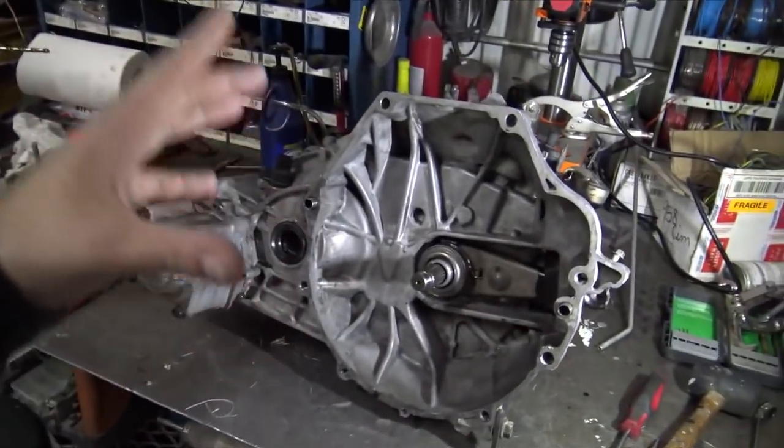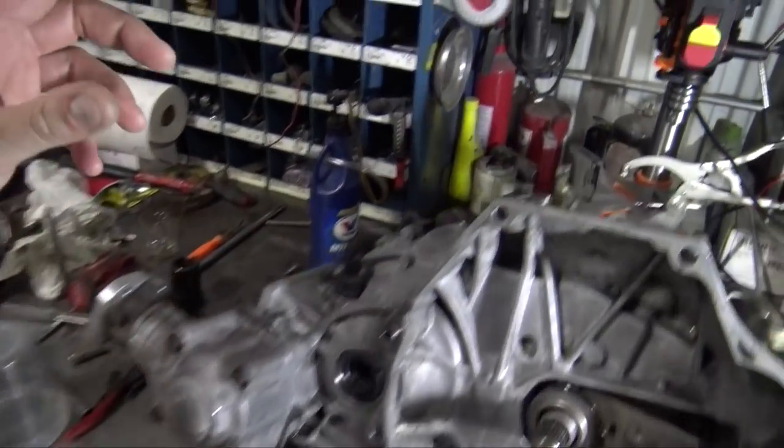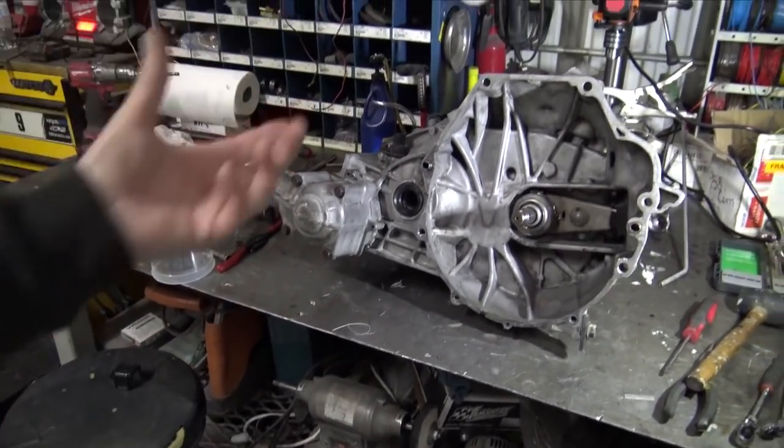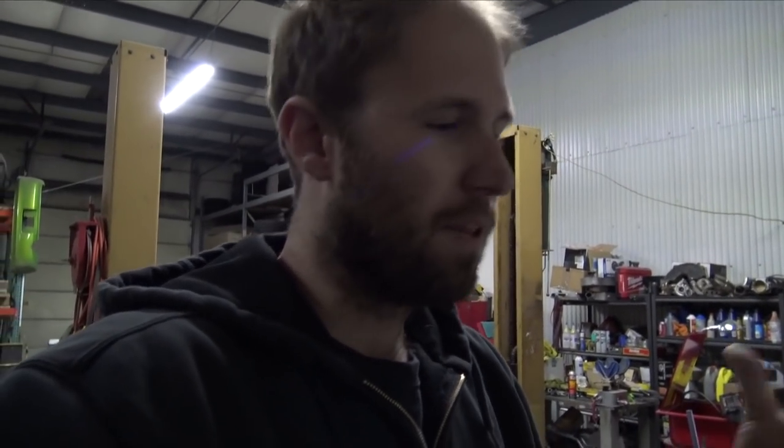There are a few little things you have to know about these. On the backside, as you saw, there's a little retaining clip, and that's really important because when you're pulling it apart, you need to have that spread. Most of the time they're kind of walked over, so you want to center it first, then spread it, and then pull the top of the case.